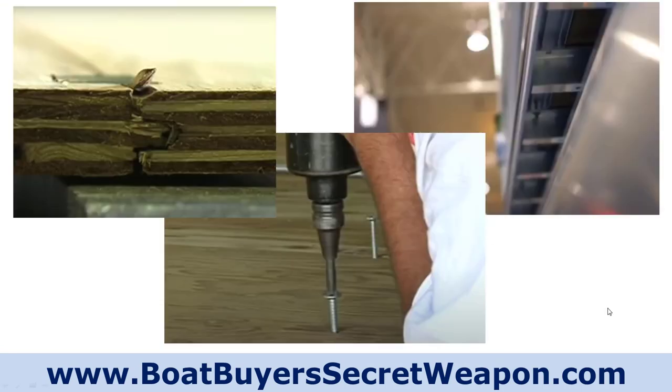By putting that full-length extruded aluminum piece and welding it to the tube, you've got a more stable base versus what some manufacturers do — they'll cut it and it won't be a single piece, or it won't be as heavy duty. Next, they use seven-layer marine grade plywood, which virtually everybody uses now and allows them to do a lifetime warranty on the structure of the flooring. Then they layer a layer of tape which reduces sound and vibration, and they tongue-and-groove that plywood together — instead of just butting it up, which can allow water to get in between and shoot up through the carpeting. Once the plywood is together, they use nice big heavy-duty tech screws — self-tapping screws that go through the plywood into the cross member, extruded aluminum — using a super high-speed drill that fuses it together almost like welding.